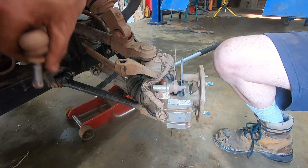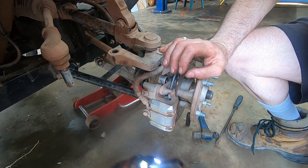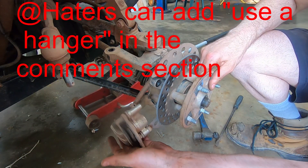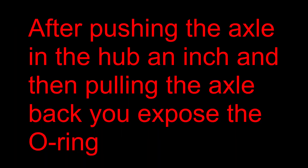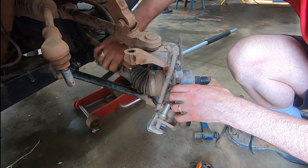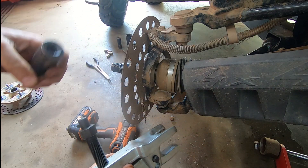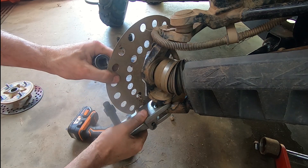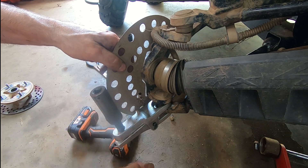Give it a few taps from the side and it'll swing out of the way. Take the brake caliper off — unlike a car brake caliper that's really heavy, this one's not. Use a ball joint separator if you have one; if not, you can come at it with a hammer while you've got a bit of a pry on the ball joint and it'll probably pop right off.